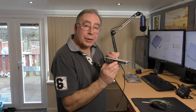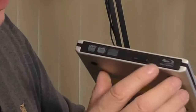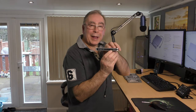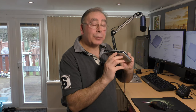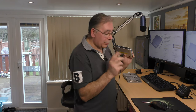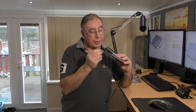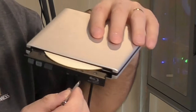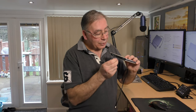If you look on the face where the eject button is, there's a little hole right there. A lot of people know all about that, but equally a lot of people don't. This is why I thought it was a good idea to do this video. In this case I'm using a very small screwdriver - just small enough to fit in that hole. And that's it, that is how easy it is.